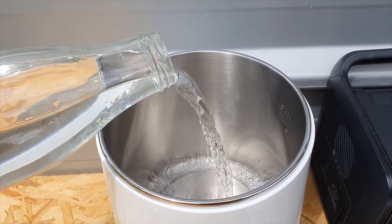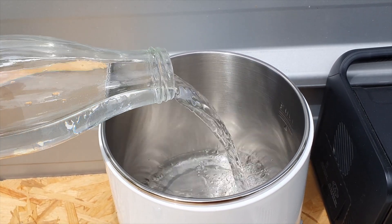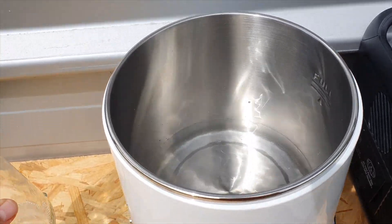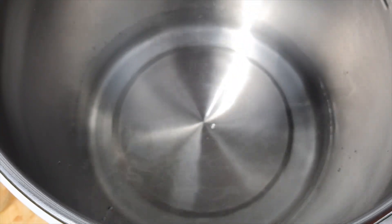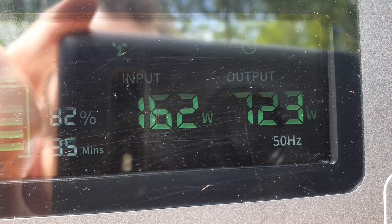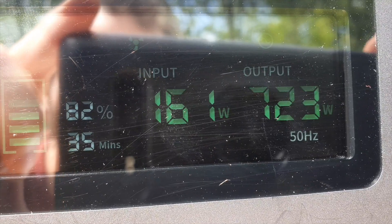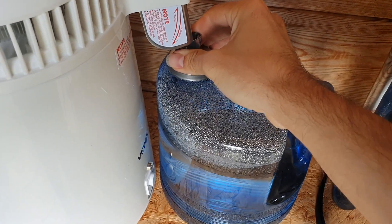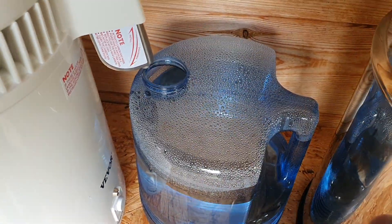You can put only two liters of water in if you want, but you'll need to be creative using the timer — that's why I recommend the timer model. It runs on 700 watts, so you'll need a substantial solar system to run one off-grid. If you're connected to the grid, you won't need to worry about this. This unit can filter four liters in roughly four hours.